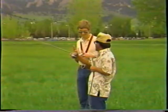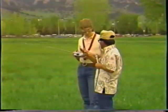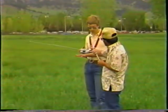So I want you to give a little flare. Keep holding the negative now. Flare with cyclic. Yep, flare with cyclic. Keep your negative. Don't touch it until you slow the aircraft, zero speed, level off, then increase your pitch.